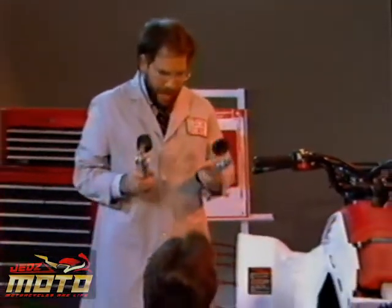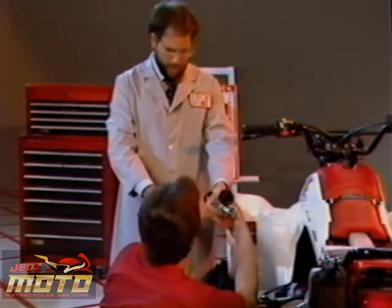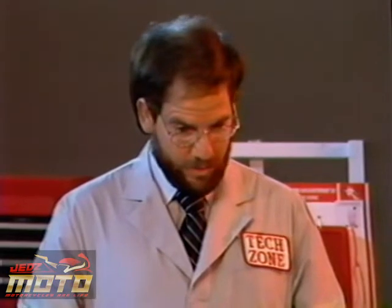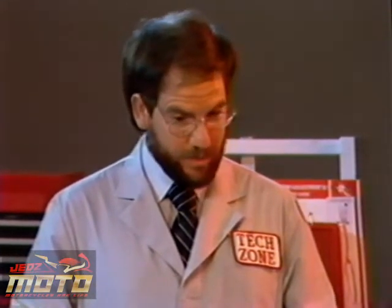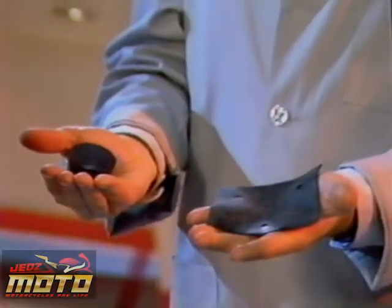Crankcase pressure and vacuum test is the only way to pinpoint an air leak, so we'll use both pumps. By the way, on some CRs, the transmission is internally vented to the ignition case, so be careful not to misdiagnose the problem. Now what?